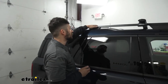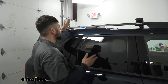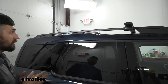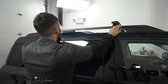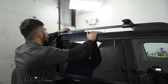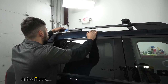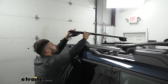Now we're ready to install our crossbar assembly on the vehicle. We have quite a bit of freedom in regards to location, but the crossbars must be spaced a certain distance apart — the crossbar spread, measured center to center, needs to be between 27 and 9/16 inches and 31 and a half inches. I recommend installing the front crossbar as far forward as possible and then measuring roughly 30 inches back for the rear crossbar. I've used a piece of painter's tape to mark the two locations.